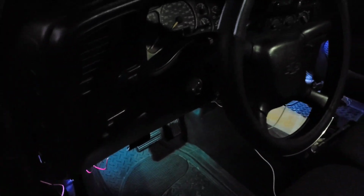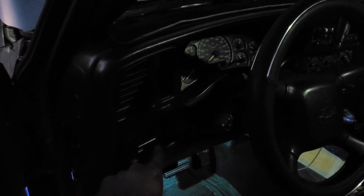Just a heads up before y'all do what I did. Before y'all put, what is going on? Okay, well, apparently that light's not gonna be bright enough. But before y'all put in the switch, make sure y'all know exactly what's the ground, what's the power, and so forth and so on. Because now I'm having issues trying to figure out what wire goes where, and I've already shorted out three fuses trying to just guess.